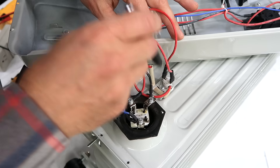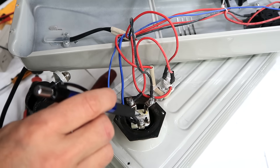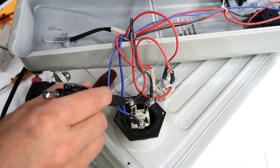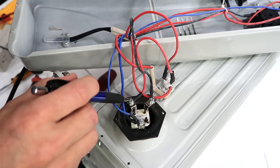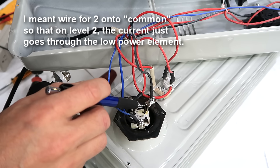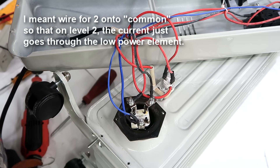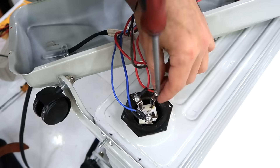So what I'm going to do is put the common on 1 and then put the 1 on the 2, so that if element 1 is turned off the current has to go through both elements in series. I'll put the wire for 2 onto the 1, so when we switch to level 2 we have level 1, and if we switch to level 3 that doesn't really do anything different — it's just the low power element. That should give me about 400 watts for level 1 and about 600 watts for levels 2 and 3.